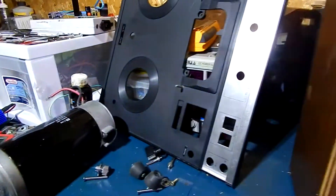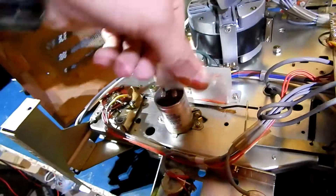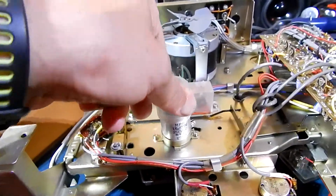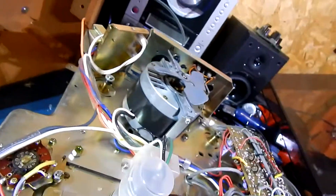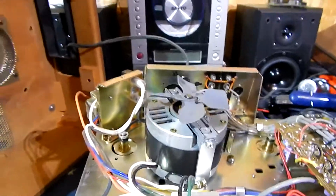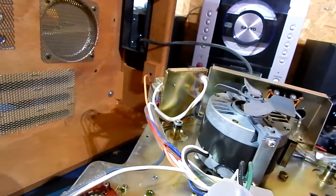Sorry about that guys — door and a delivery. Okay, here's the starter cap for the motor. That could be the problem right there. We'll have to do some tests. There's actually something underneath there that we'll have to take a look at too. I don't think it's the motor itself — it doesn't look to be blackened or anything like that. It looks pretty clean, actually. So we'll do some readings off the obvious stuff like the voltage and everything else.